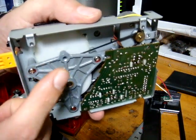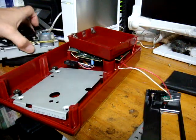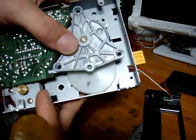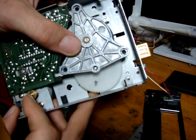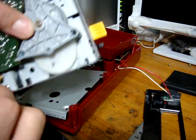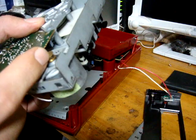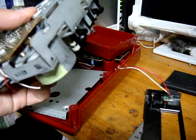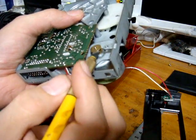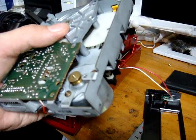This one already has a working belt in it, so I have an identical one to demonstrate. This is what the bottom should look like if you have a disc system with a bad belt. You might see parts of the belt still sticking here and wrapped around the bottom pulley — that's really normal. Try to peel that belt off and scrape away as much as you can using a flat screwdriver or your knife. Afterwards, try to use some sort of oil or grease remover to get it as clean as possible. It'll save you a lot of hassle.